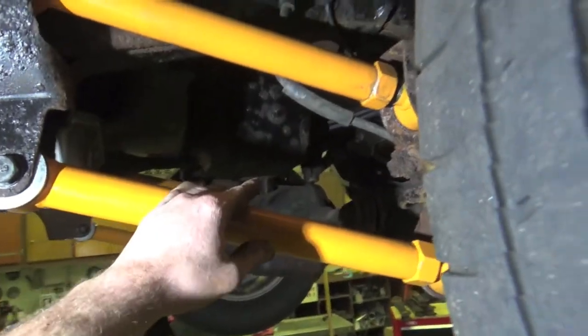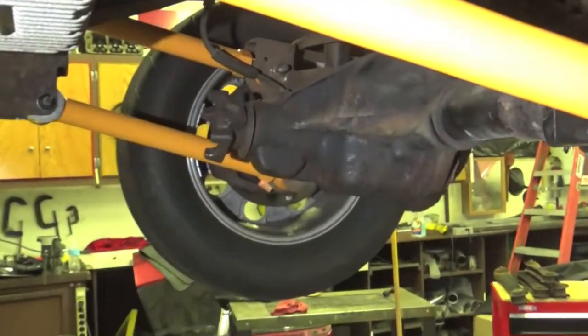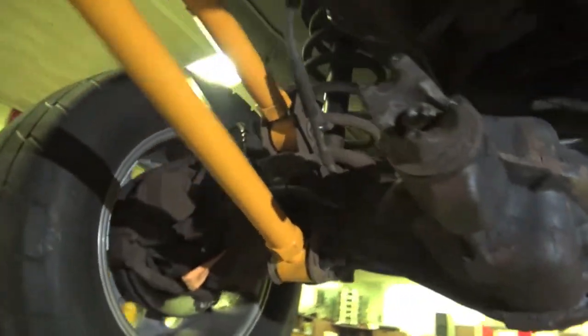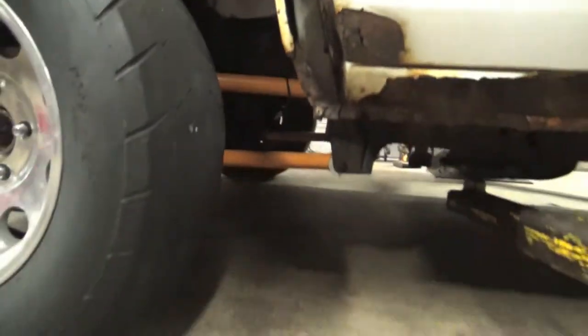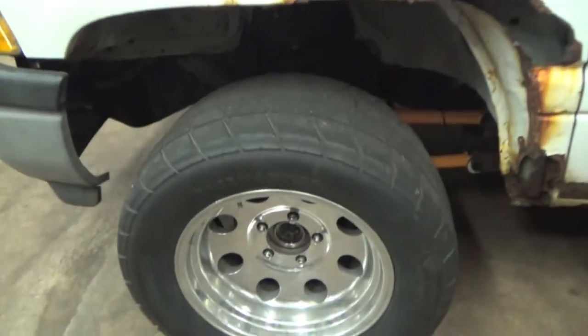These have polyurethane bushings and we have adjustability on it. Definitely after you get these installed you're going to want to take it and get an alignment. When we get our front differential all put back together, I'll probably adjust it a little bit better to get the pinion angle correct, and then we'll do a tape measure alignment to get it all perfectly good. These guys are absolutely beautiful and absolutely beefcakey. Let's set it on the ground and see if we pushed the axle forward about a quarter of an inch. With her all the way on the ground we are definitely forward just a tiny little bit more. You can see the big beefcakes right there hanging out down there nice and parallel. I think she's ready to 4x4 launch but we'll have to make her a true 4x4 by putting that front locker in — we'll save that for the next video.